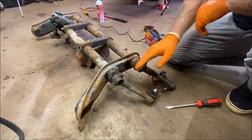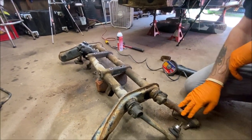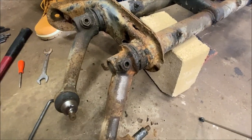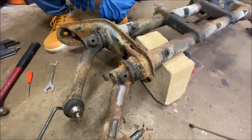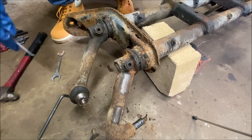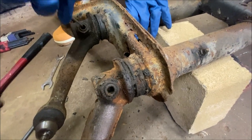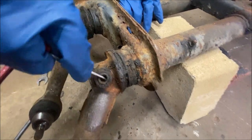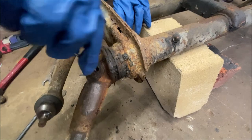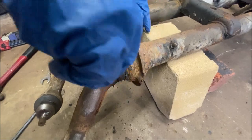What we've got going on next is taking the arms off. And after that, the steering box, then the torsion leaves. Now, what we've got to do is get the torsion arms off of each side. We're going to have Heather go ahead and remove these. She's cleaning the Allen head bolts first.